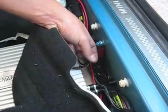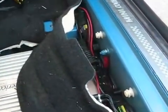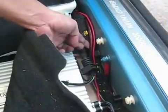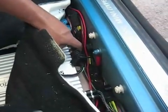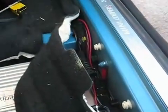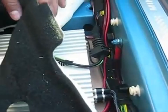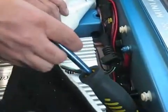If you notice, this is a really nice ground plane — Mini went ahead and left ground planes here and here. This is the one I used, and this is the power coming in from the battery. This is my signal — I ran everything through here, which is probably not the best thing to do because you'll get a little bit of alternator noise. You can also always run the signals through the center console and run them down.